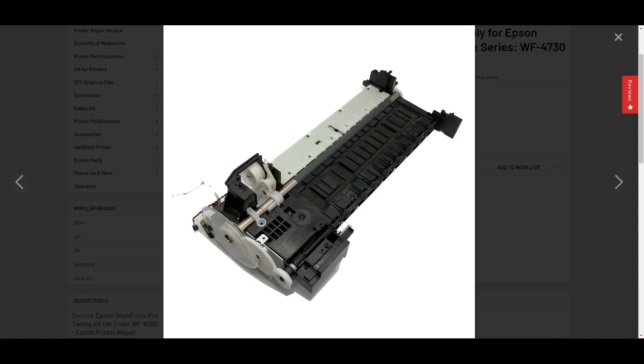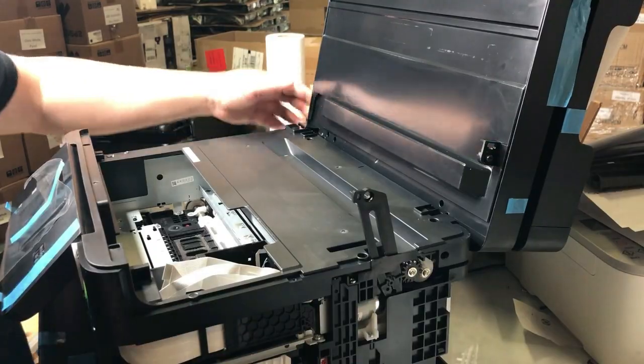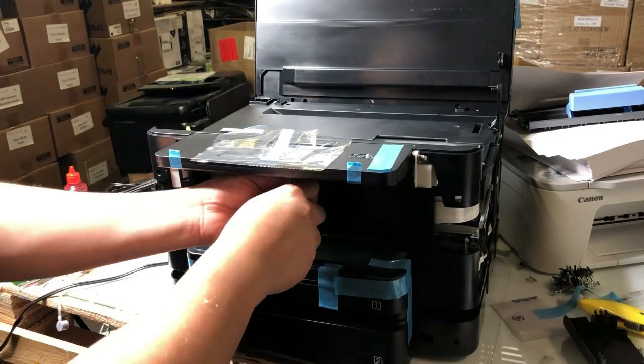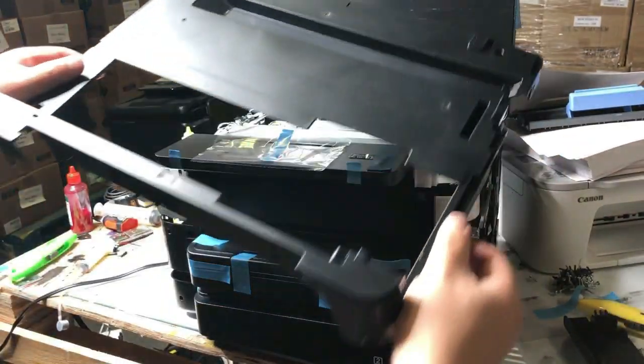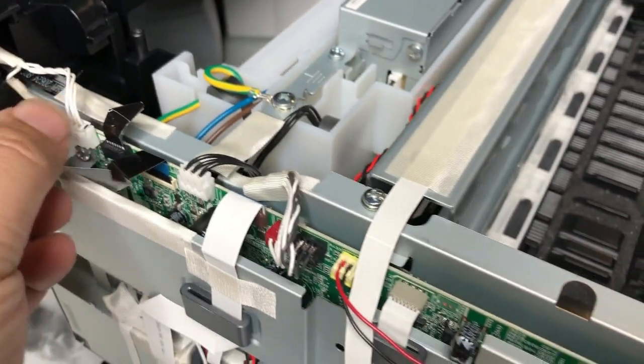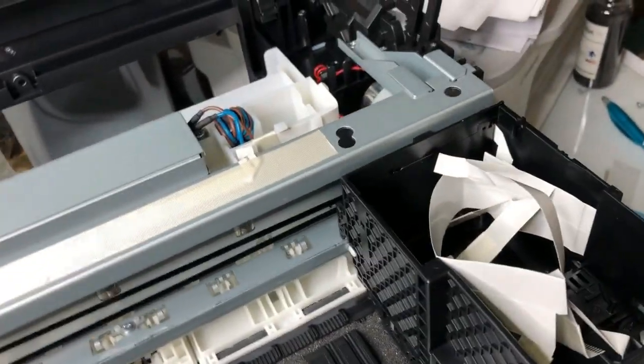You'll be looking at this part. I think there's a gear wheel and a really large spring. You can find both in your printer and try to pop it back to see if it works. If not, try eBay, and then you might have to bite the bullet. I have an uncasing video — I'll put the link above. That video will show you how to take the printer apart, remove the scanner, and remove the top casing. Then you might find the problem is you don't have enough space to work because this motherboard is in the way. So I'm going to show you how to remove the motherboard.